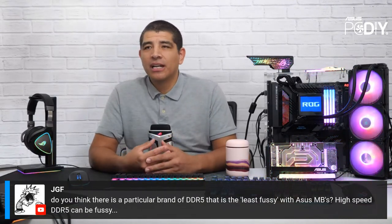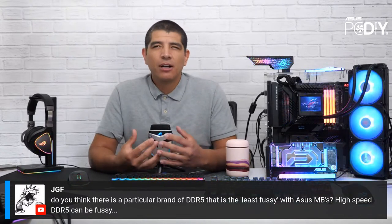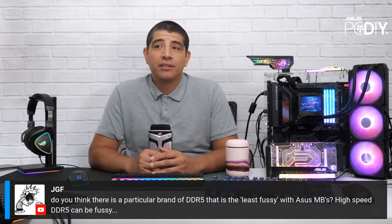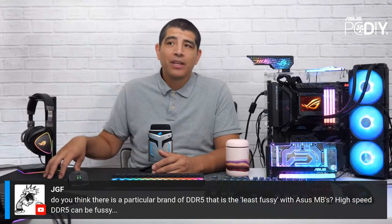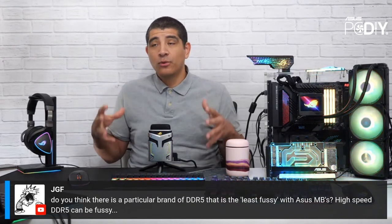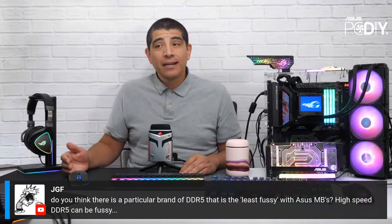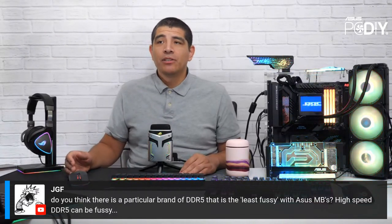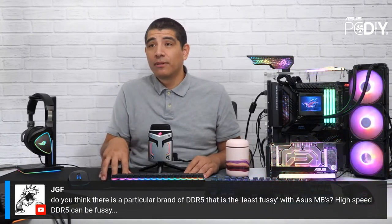So in our analysis, if you took 10 CPUs, on average approximately 80% of those CPUs are going to be able to hit a 6,000 MT memory divider, right? Because keep in mind that the default memory divider for 12th gen CPUs is 4,800 MT. Anything over that is an overclock speed. So it's not so much about the memory being fussy. It's about the fact that you don't know the quality of your IMC.